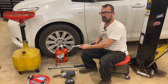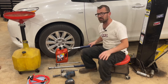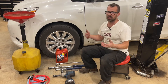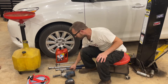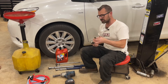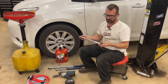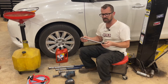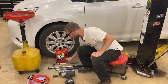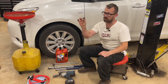I've got a 3/8 torque wrench, and I've also got a half-inch drive. You can get by with one and just get the appropriate sockets if need be. I've got a half-inch ratchet with a 24-millimeter socket, and then a breaker bar. Makes it a little easier with a 10-millimeter hex bit on it, and I also have a 6-millimeter hex bit that we do not need to put a wrench on.